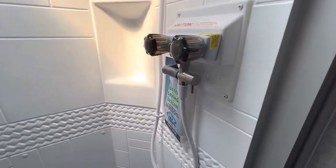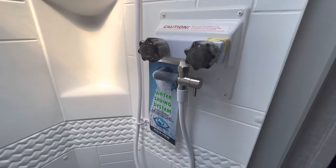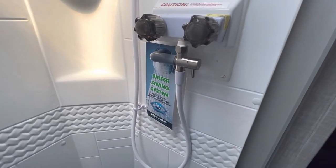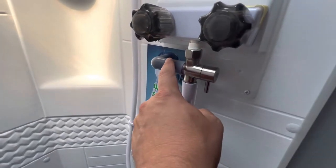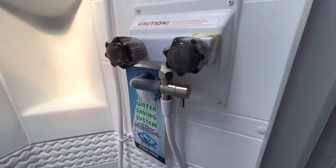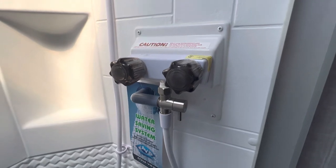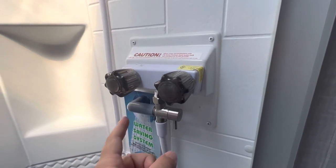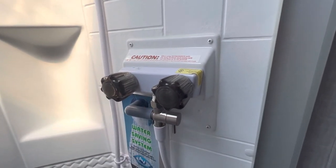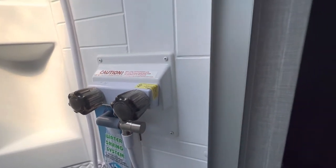Something else that's really nice: if you find yourself camping off of using the water tanks instead of a water hookup, you have this water saving system — it's the Shower Miser, the AquaView. What that is, is this tube right here. It's kind of an opaque color right now, but it will basically turn white when the water hits 90 degrees. It'll recycle from your fresh water tank into your hot water heater and then back into the fresh water tank until it hits 90 degrees. Then you just switch this lever and you have hot water right away.